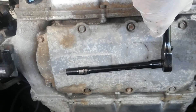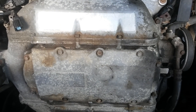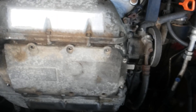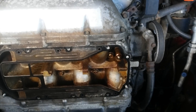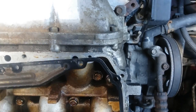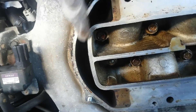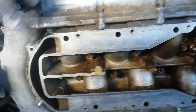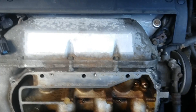Use the 10 millimeter to loosen and take this bolt out. There's the gasket — make sure it doesn't break. Another video previously posted shows how to clean the EGR intake. Just to recap: once you open it, you'll probably find it's full of carbon, so you can clean this. It's connected to the EGR valve right here, so it's the opportunity to clean all this as you take the plenum off.